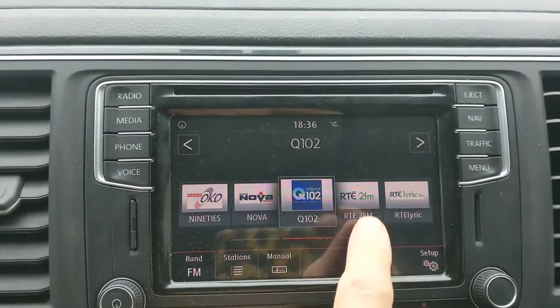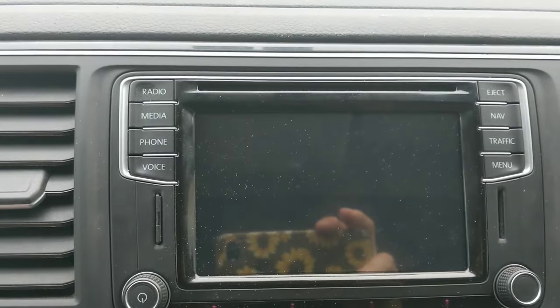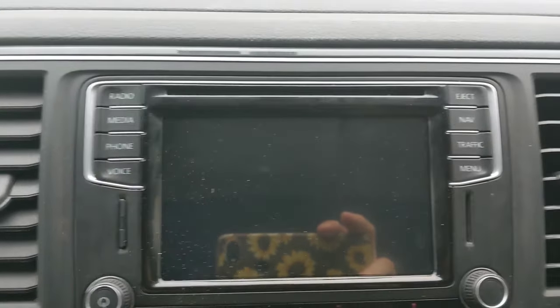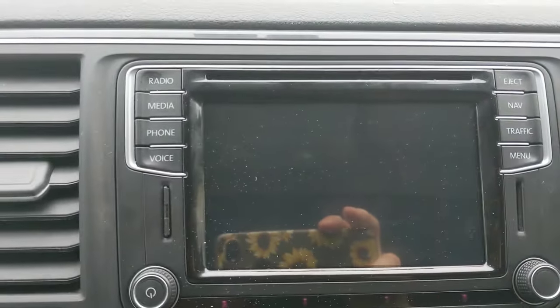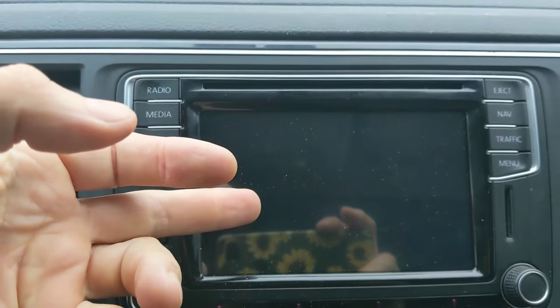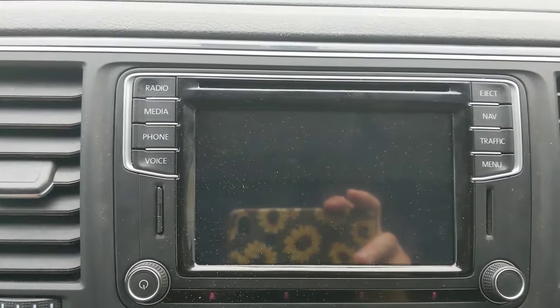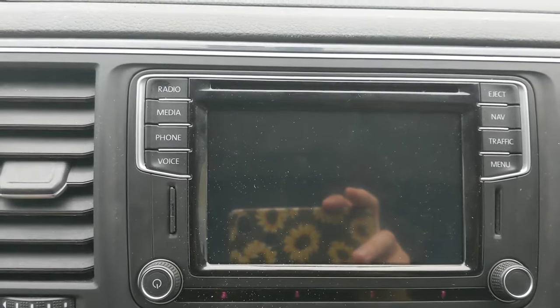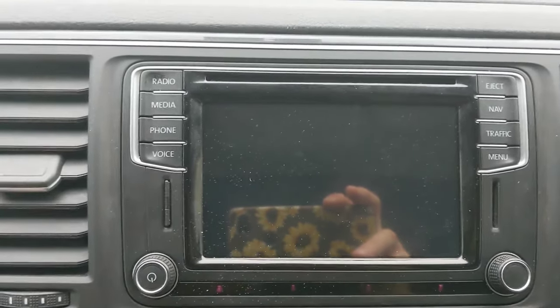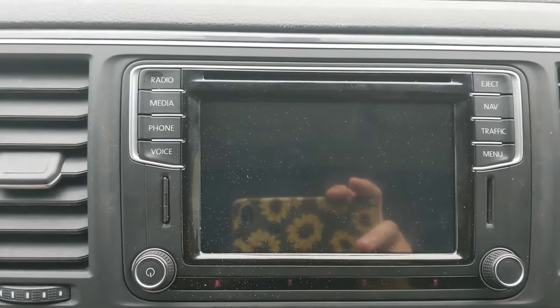Whereas you can see it is fixed. So do that, take it out, dismantle it. The tricky bit was that the touchscreen and the actual display are bonded together, and you need a temperature controlled oven to reliably loosen the glue between the two.